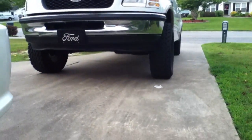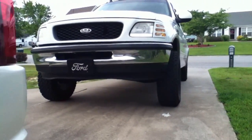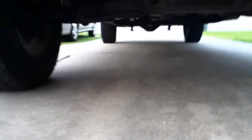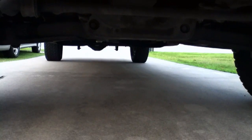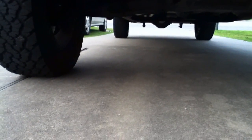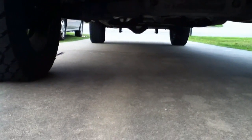There's a lot more clearance obviously, and that's one thing that's cool about these two wheel drives with a spindle lift — it lifts everything. It just pushes your tires down so you've got more clearance at the lower control arms, and the center of the truck everything is higher. Not just the A-arms push down like if you were to crank keys on a four wheel drive.